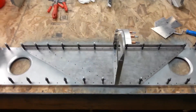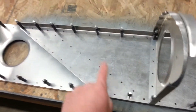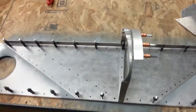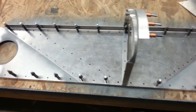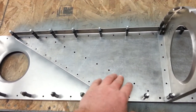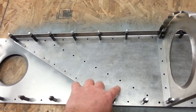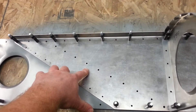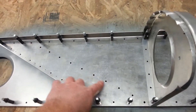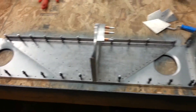Another modification you have to do is enlarge the doubler. The old doubler ends here and here — the old one across the top is 630 millimeters, the new one is 820 millimeters. The attachment point for the struts originally is here; I didn't change that, but you can see how much bigger it is. I'm using a piece of one inch by one inch here instead of three-quarter, just to give me a little more bolting surface for the wing strut attachment.